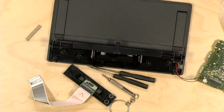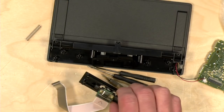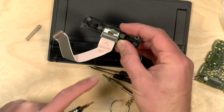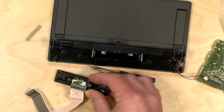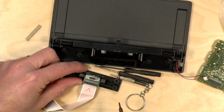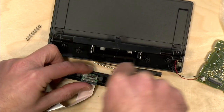All right, so let's see where I left off on the last clip here. So I'll cut back to here. 3, 2, 1. So we got the USB-C connector here extracted from the old dock, or at least this part of it. Now the instructions call for unscrewing these two screws here, and unfortunately the included screwdrivers are not good enough to get those screws extracted. In fact, I'm very concerned about stripping the screws here because they don't quite fit, and because this thing is on a spring, it's hard to get a good grip on it with the screwdrivers they include with it.